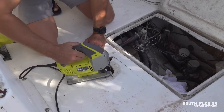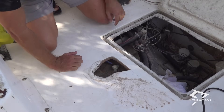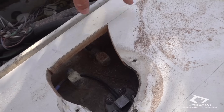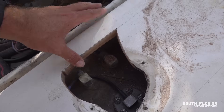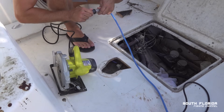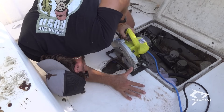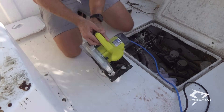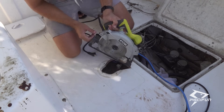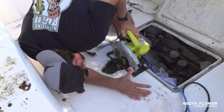Now I'm going to make a cut here to break that off, and you can see — there you have it — these are the fuel intakes I was trying to get access to. There's one more right here, so we just have to finish cutting. It's going pretty smooth so far. This is probably where something could go wrong — I really hope I don't cut into anything. Actually, my blade looks a little too deep; it sticks out like half a centimeter. I want a little less than that — let me adjust it. All right, that should be good.